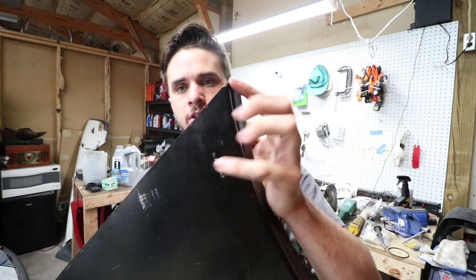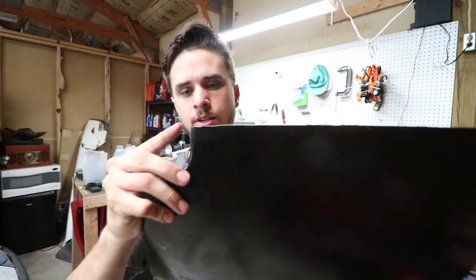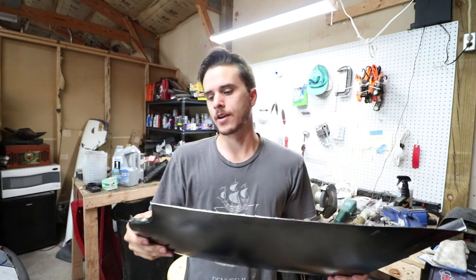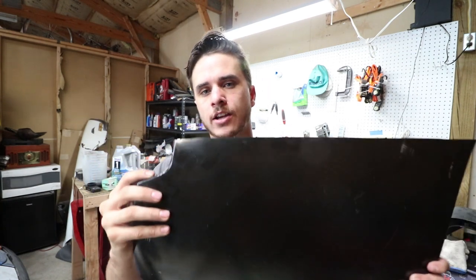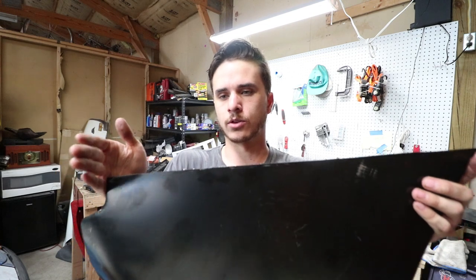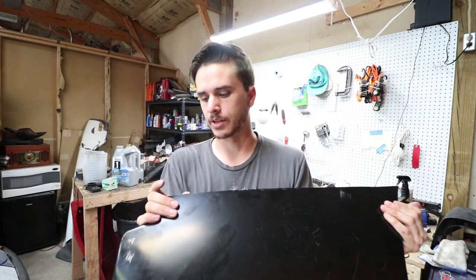If I line up this part — which is the fender around the wheel — if I line up this corner, then this comes up short on the quarter panel. There's a gap that needs to be filled, even though this right here isn't tucking up against the other panel. You would think it would need to be cut shorter, but that would shorten the overall length even more and make the problem worse.